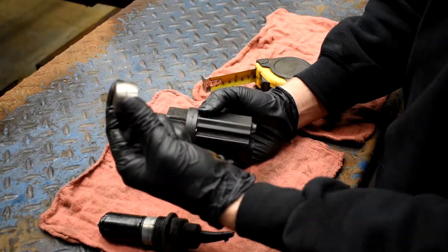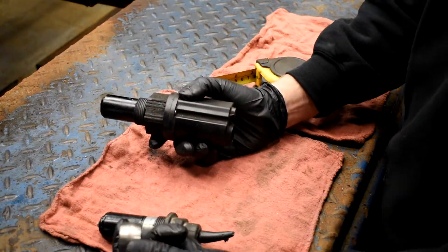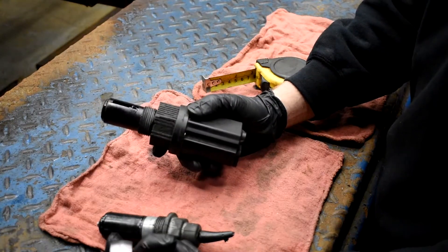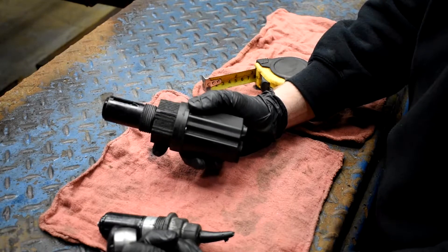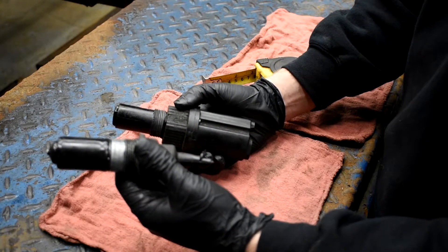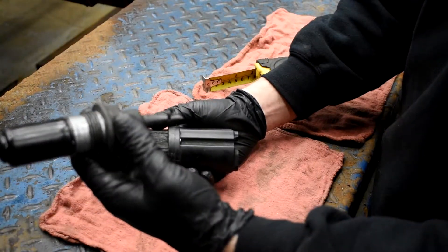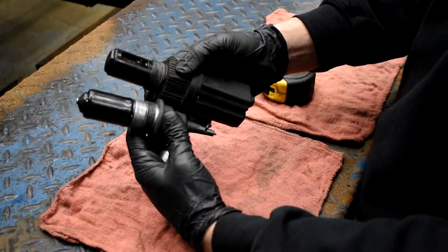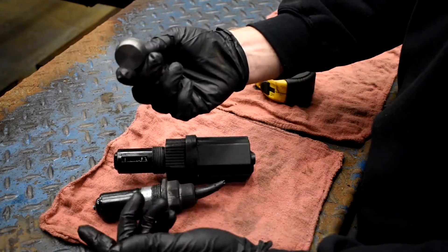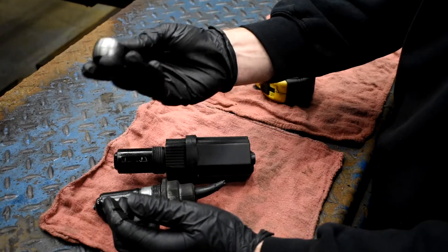With that kit, they'll give you this spacer piece if you have a 97 and under truck. But say you have a 98 and above truck like we have on the lift today, and the customer supplied an axle from a 1997 truck that came with the older style actuator. The truck itself has the newer one, but the axle has the older one sitting in it. You can either have this spacer machined, make one out of black iron pipe, or it comes in that Dorman 600-600 kit, which is where we got this one from.